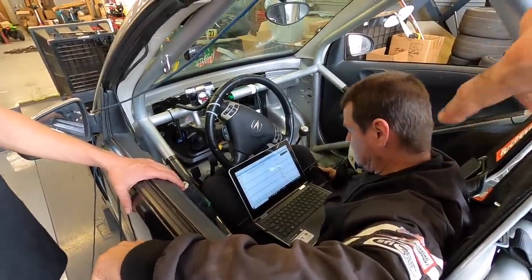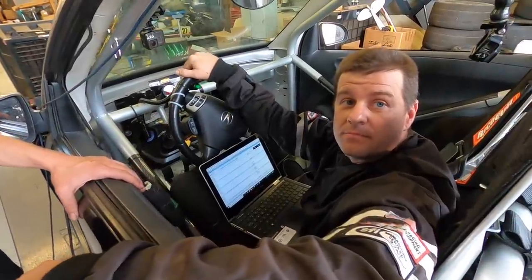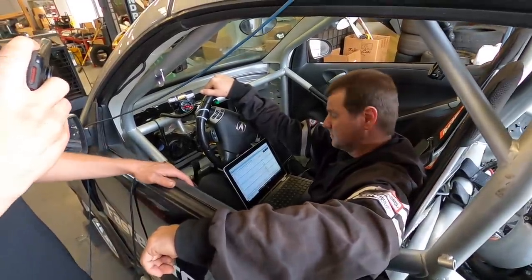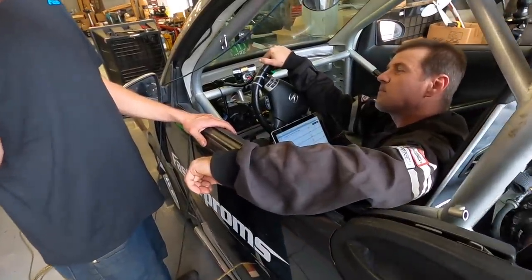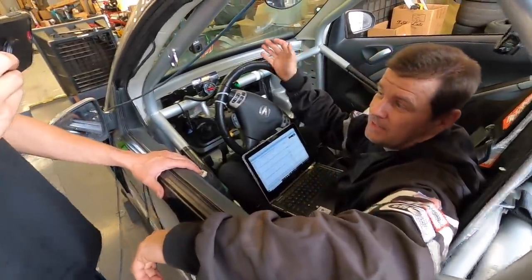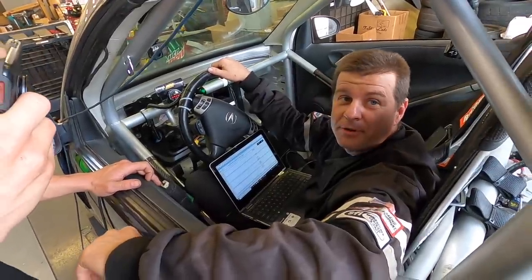Yeah, so then we just need to soften the gate. We have to soften the gate because that is the gate. We need to be able to have as low as it goes. That's as low as it goes. Oh, dang. Yeah, so that's what I'm saying, I'm fine with that power, but we need to be able to go beneath that and then just go up from there, because this is super conservative. My limiter right now I had at 7,900 because I didn't know where we were going to go, and I hit 73 right there.